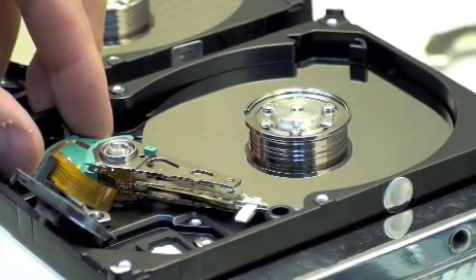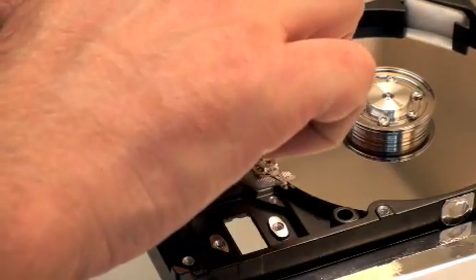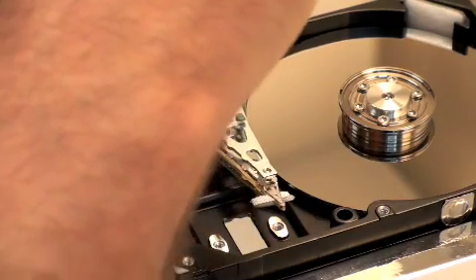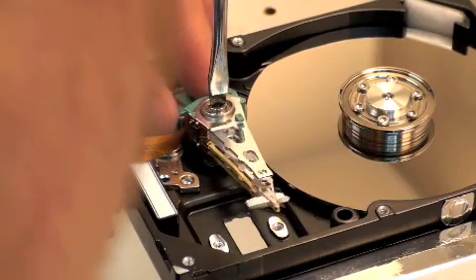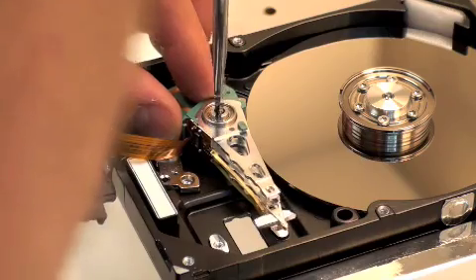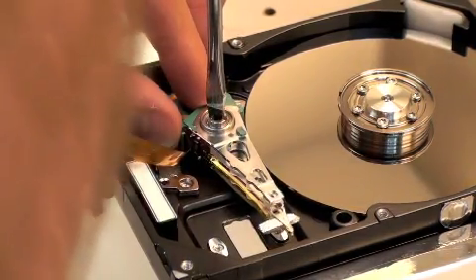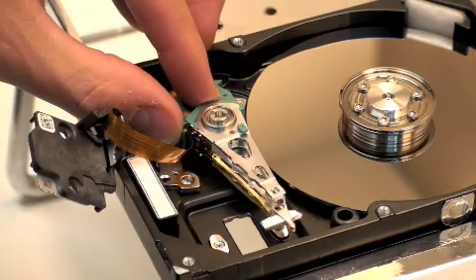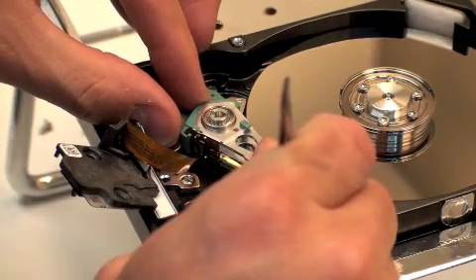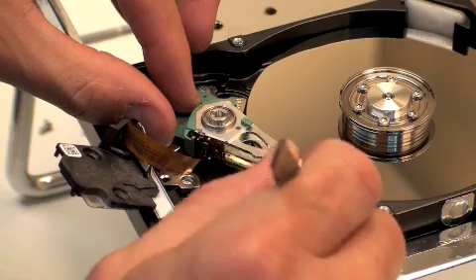You may have to practice a little bit with the tool, or the thickness of the foam and the things that you're going to reassemble. But again, this is another clip from another video where I'm showing the basics of how to do simple head replacement. The heads are being held apart. I pulled it straight off the platter just like that without having to have any other special head comb tools or anything along those lines. And I've gotten to where I can make each one of these that I want to use in a minute, minute and a half. This is one of the easiest methods I've found to do this, as opposed to buying some $200 head tools that are out there. There are some that come in handy in very complicated situations where you have six heads or something along those lines. But I believe that you will find that you can build these foam pieces out of foil and that they will hold up and survive the test of time.